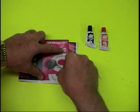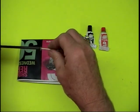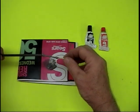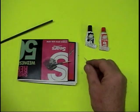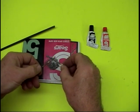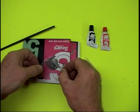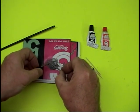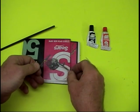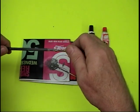The only thing I would suggest: if you have two choices — there's quick dry 5-minute JB Weld and long dry, which is about 45 minutes — you're probably going to be a lot happier with the result of the 45-minute long dry. It also gives you a little working time. We want to take that push rod that has the one end, because we're going to have to improvise here. When people have a ball link failure, it's almost always that they've done something wrong — not sanded inside the part. In the past, if the fit was too tight, all the JB Weld would squeeze out. Now with those little ridges, there's a lot less chance of that happening.